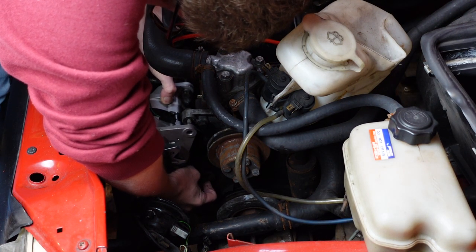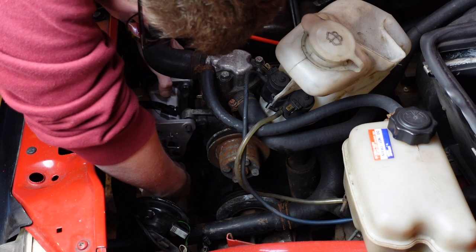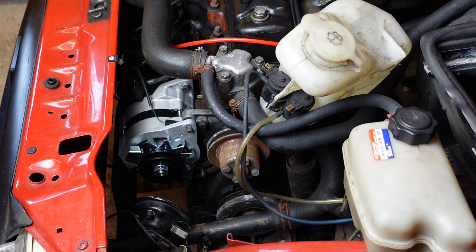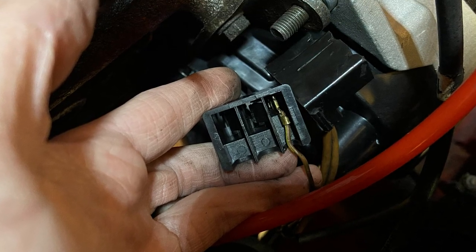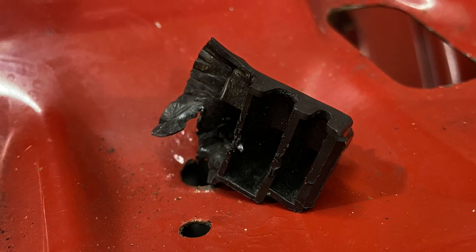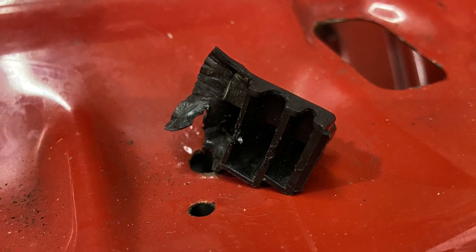But there's another problem — remember the plug from before? Well, it's too big for the new alternator. The pins are the same, naturally, but the housing is physically too big. Having waited another couple of days for a new plug to arrive, I began depinning the old plug. The first two came out as easily as you'd expect, but did the third? Of course not. This is how mangled that plug looked once I'd fished out the final pin. I didn't want to simply cut the wire and repin it as I'd lose some length in the loom, so it was worth the faff, I suppose.